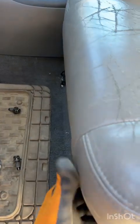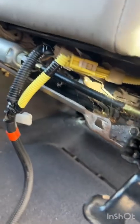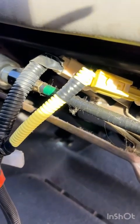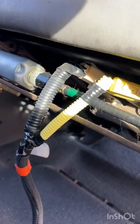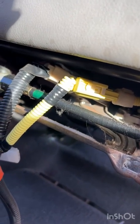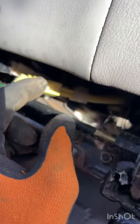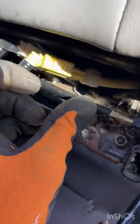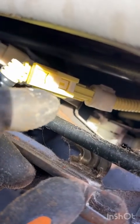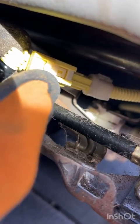To release those two wire harnesses, go ahead and tip the seat back and look under here. Now, the black one, which is the electrical, is just an easy push tab. The yellow one, which is for your airbag, is a little bit different and it can be tricky. You need to slide this little white tab in here backward this way, because there are two little springs in here that keep it pushed into place, and then it will release.